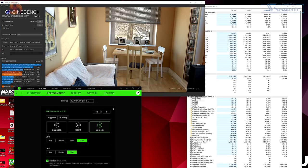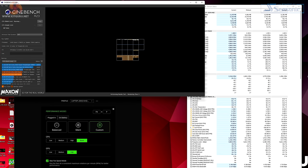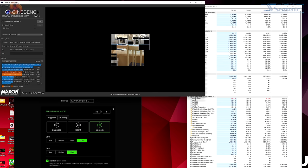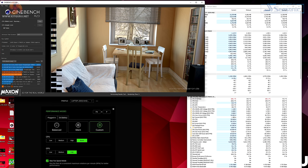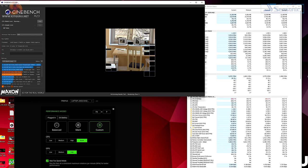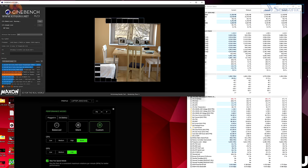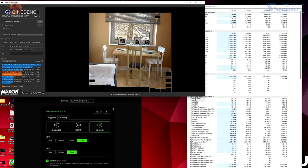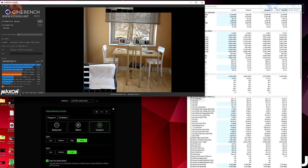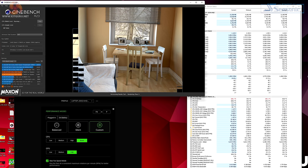Going all the way with GPU on high and CPU on boost: the GPU has 100W and still runs at 2.28 GHz, while the CPU pushes to 50W and 4.2 GHz. In CPU-only tasks where graphics aren't loading the cooling system, the CPU can run at 4.5 GHz on all cores pulling 66 watts. As we change settings in Synapse, the fan speeds adjust to suit the vapor chamber cooler. When we push up to boost, the fans slowly ramp up to full speed, and that can get rather noisy.